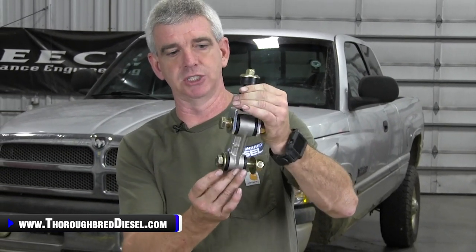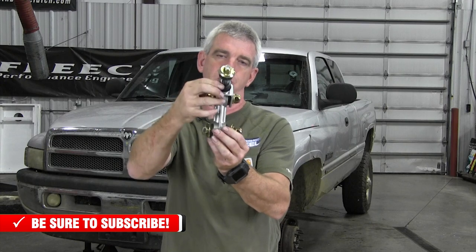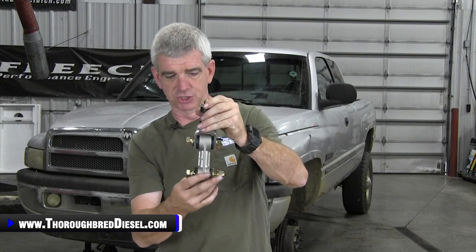Another good thing about this is the articulation of this sway bar end link. You have some articulation at your axle position, and a little bit of natural articulation because of the bushings, but that articulation is pretty limited on stock units. With these jointed sway bar end links, it's really nice because you're not putting as much pressure on the bushing points that are actually controlling your sway bar. The front-and-back movement you'll have in the axle or the sway bar is handled by the joint, but when it comes time for the truck to lean — the vertical direction — this is going to be rigid. The upgraded polyurethane bushings are going to really take the abuse of that.